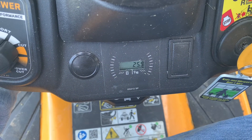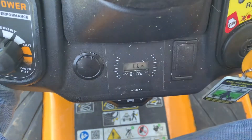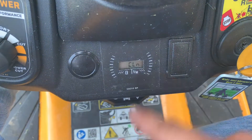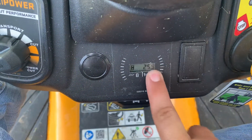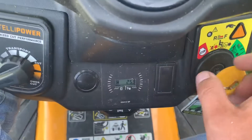As you guys can see, we have our first service issue: battery voltage hours, and it says 'clean air filter.' After looking in the owner's manual, I did see where it says you're supposed to clean and check the air box every five to ten hours. But the service message is telling us to clean the air filter, so let's go underneath the hood and see what we got.